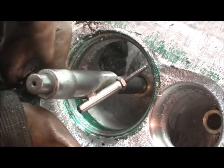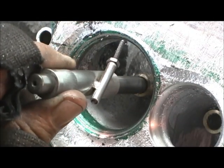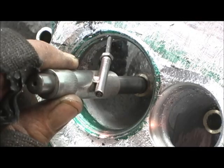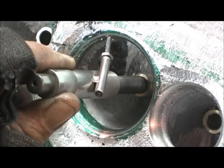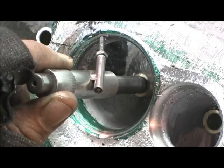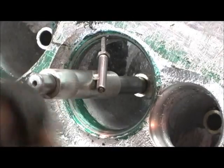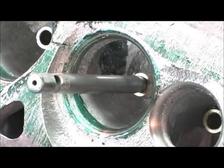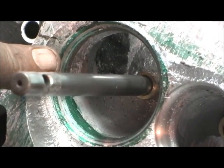In this application right here, this is a full race motor, so it's going to have a radius unlike a lot of performance or street strip cars do. The reason I do this is it gives me a circumference up underneath the seat. You can see the gray area in here, which is the actual valve seat and how the line is right up underneath it.